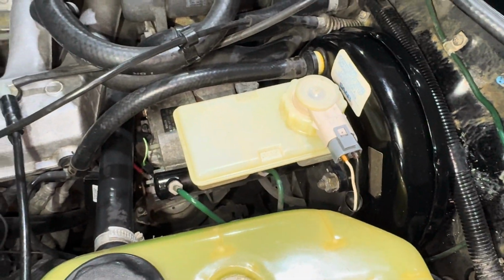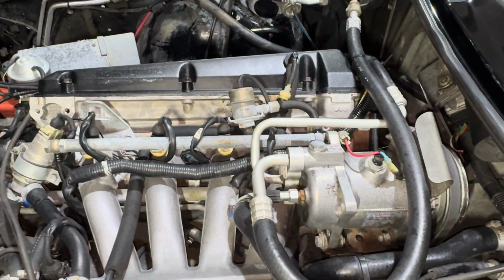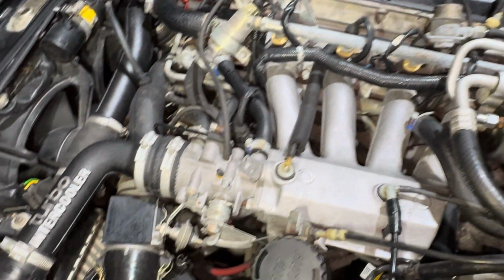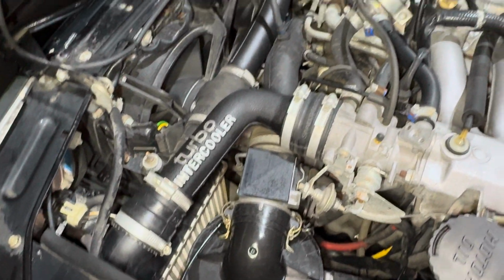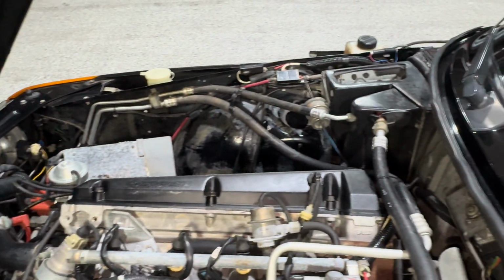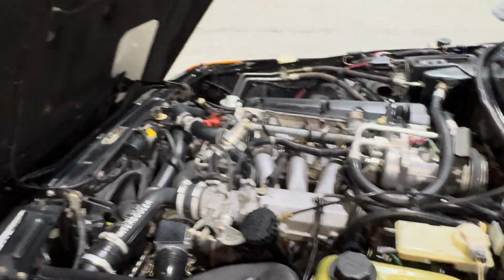And there's the brakes. They're all new, rear and front calipers, flushed the whole system, new pads, turned the rotors, all of that. Completely went through the brakes. And also new hoses too, I forgot to say that. New brake hoses, there was 5 of them, I think. Something like that. So there is underneath the hood.